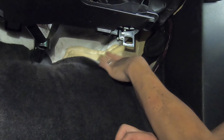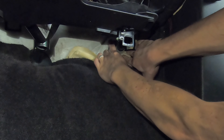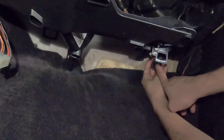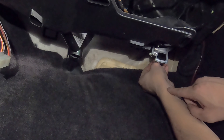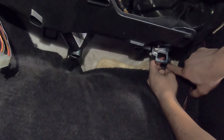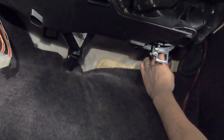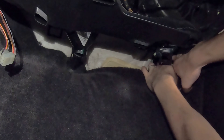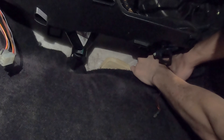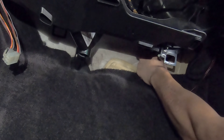Here is the sunroof drain — right here. Let's go ahead and pull this out and take a look at it. My port already has the tip cut off, but if yours hasn't been modified it's going to have a really tight pinch on the end. Just take some scissors, snip it off — that's going to give it a bigger opening. This part is extremely important: when you put the port back into the firewall you need to make sure it's seated 100% properly. When you push it in you should have a hard time pulling it out. If it comes out easily, you didn't seat it into the firewall all the way. Make sure it's good to go, because if it's not, water is just going to drain into your footwells.